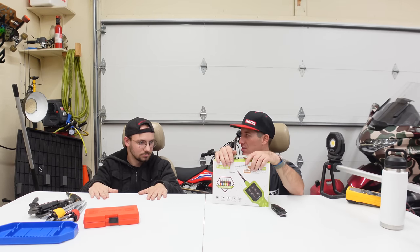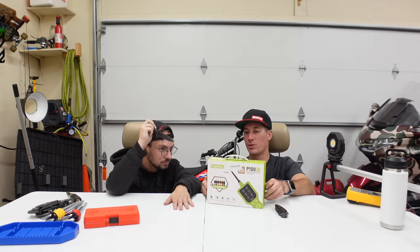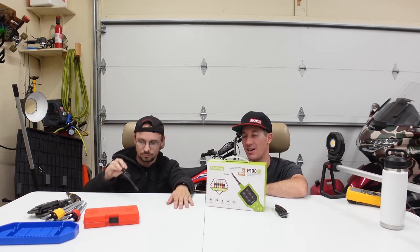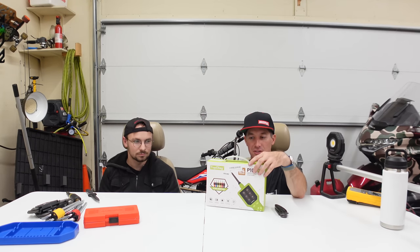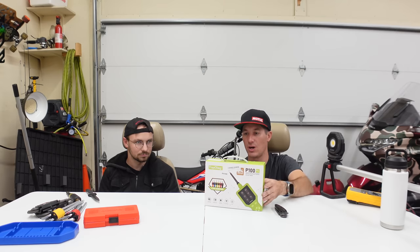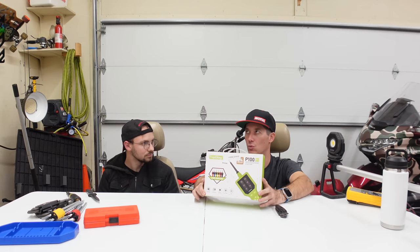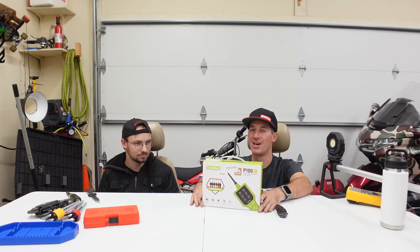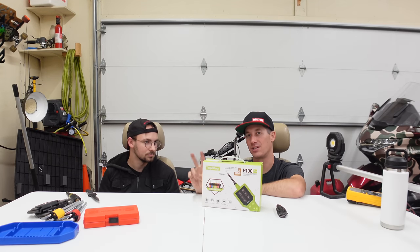The most expensive thing in this entire video is the TopDiag P100 Pro. While we were working on the Bentley, James from Air Capital Diagnostics brought over the Snap-on Power Probe Ultra and I was in love with it — it shows current draw, has a super nice long cable, shows voltage, and you can turn the output on and off. This is a Power Probe for one fourth of the Snap-on price — it was $80 — and it has an oscilloscope in it, so I bought it immediately. It also has a zero to five volt adjustable power supply.